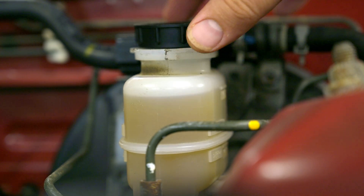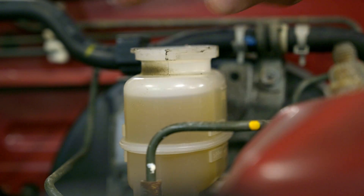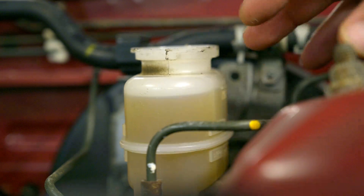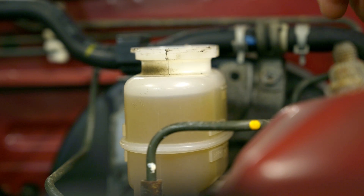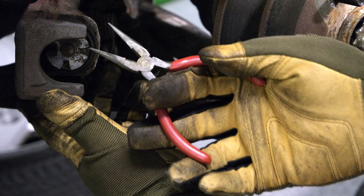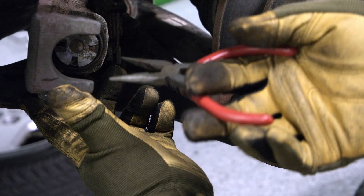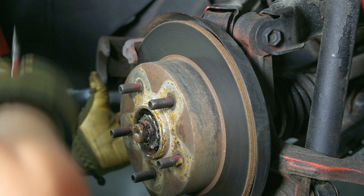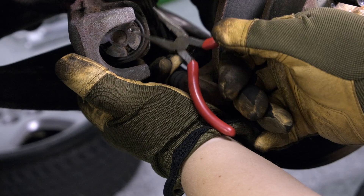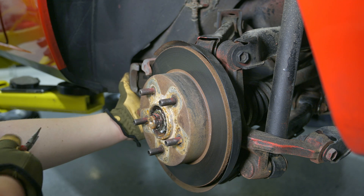Now one thing we need to do is open this reservoir for the brake fluid — trying not to get any crud in there. We keep that open when we push the pistons back. It's very important that you put a towel or drain some of the fluid, because disengaging the piston to put bigger brake pads in will cause the level to overflow. Now before installing new pads, it's very important that this piston is rotated inward using some pliers — you go in these holes and turn it. You also want to make sure the boot around the piston isn't getting caught; straighten it out if it is and check for rips. You may need to rebuild the caliper.